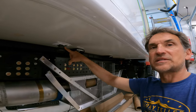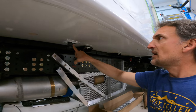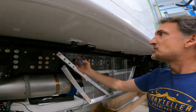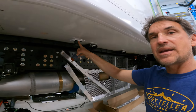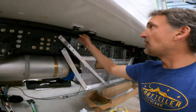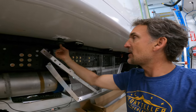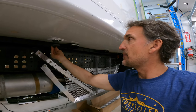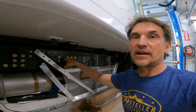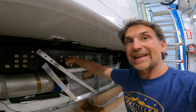Much like I've done here with this bigger bulkier fitting — same thing — I've got a glued-in fiberglass strut, an EPDM seal between those, this glued in place with Sikaflex, and then tightened down so it's completely a solid pipe all the way through when you interconnect the two pieces, clamping from the top and clamping from the bottom. The great thing is I can remove this if I ever need to, and I can now screw in a nipple or an elbow to go right into my gray water tanks through this hole in the frame.